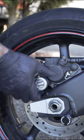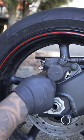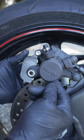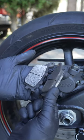Break the caliper bolt loose. Now watch — this bolt comes all the way out like that. Now you see the second bolt; slide this upwards like this, and the pads come out. From here, you can just pull the pin out, and there are your brake pads.